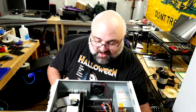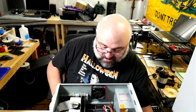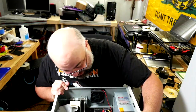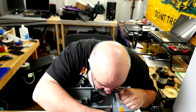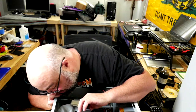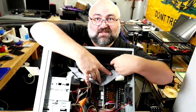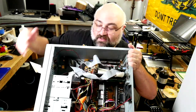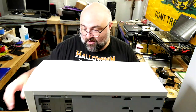But I found a USB mass storage driver because Windows Me had that but Windows 98 didn't. The guy can use these two USB 1.1 ports — 12 megabits per second, roughly 1.2 megabytes per second, which is not much smaller than this whole floppy disk. So he can go ahead and use a standard USB flash drive to get the data off. The GA-6BXD board — is that Gigabyte? Oh my god — ISA slots! This computer came to me with no side panels. The guy wants to do his own data copy — who am I to stop him?